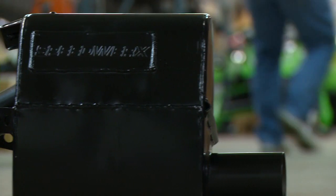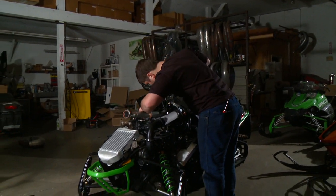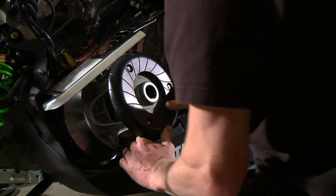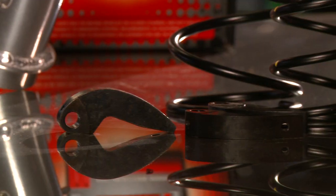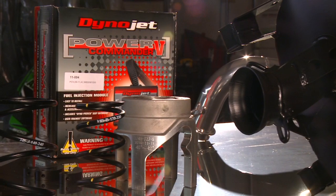They sound very similar to stock — there's a sound clip on our website you can check out. We highly suggest our charge tubes. The stock charge tubes under higher boost levels will flex and stretch, and over time they'll start falling off. They also dissipate heat a little bit better, and lower intake temps produce more horsepower. On top of that, our standard HyperShift clutch kits come with a new helix, secondary spring, primary spring, and a set of our aggressive profile adjustable weights. All those components complete your Stage 1 setup.